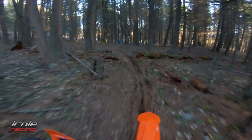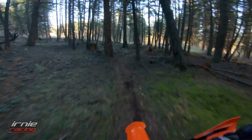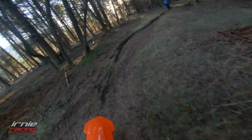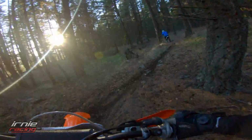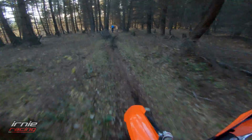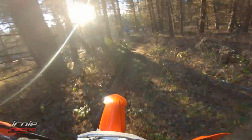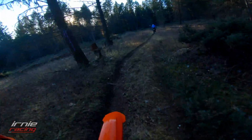Okay, what gear am I in? Second gear. Second gear is single trail. It's a little faster trail. I could put one bigger sprocket on and it might be even better. There's first gear, but this first gear is too low. And we get second and third. Lots of gears, lots of different sprockets to play with in different rides. It's like street biking, you change them every track. A lot of people just put one on a dirt bike and call it a day. Well, I know why, but you can do it.